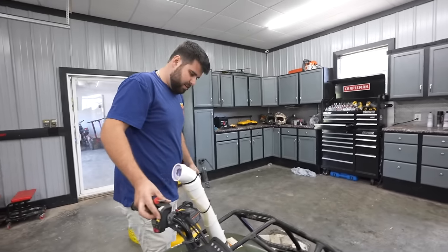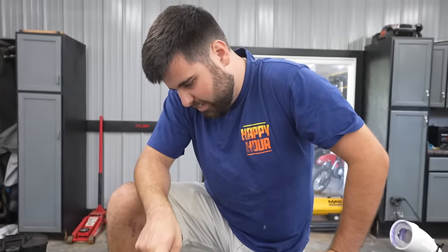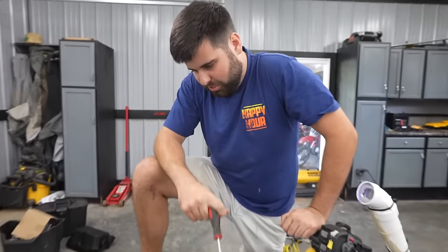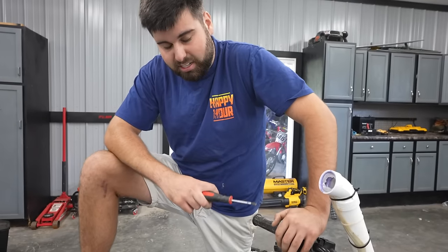Interesting. Do the headlights work? No power. So there's no power coming up here to the handlebar, but if you hit the solenoid and jump start the solenoid, it will start. So what could that be? Because that means it's getting plenty of power. Everything up here in the dash just isn't working, which means electric shift won't work.